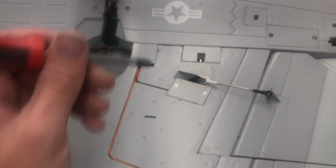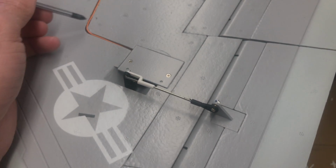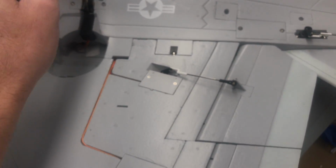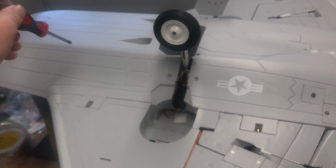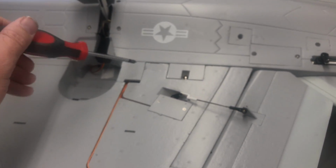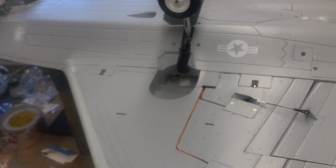Plug it into the second one, again, for your red and green marking lights. For your strobe lights, you're going to also run the same direction all the way to here, but you're going to run in and you're going to follow the ribbon band all the way up to the front board. Okay, it's kind of a pain, so what I did is I pulled the ribbon band out up to a section that's right up here to where I could still reach it, and then I taped the wires to this end of the ribbon band, and then I pulled the whole ribbon band through, pulling the wires through. That was the easiest way.